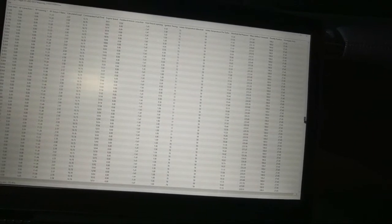So it's probably the typical FA bullshit where they pull away too much timing. I mean, here I am at 1 degree of timing at 5,200 RPM. Like, what is that, right? That's just FA-isms for you. It's one thing I freaking hate about them.